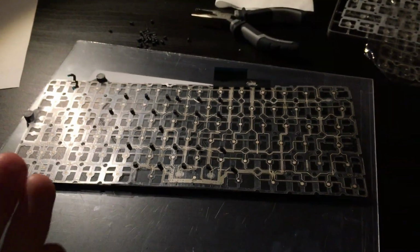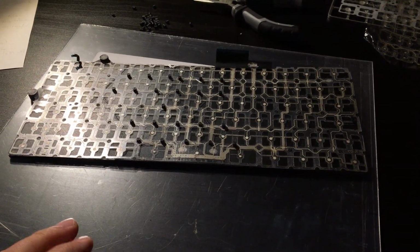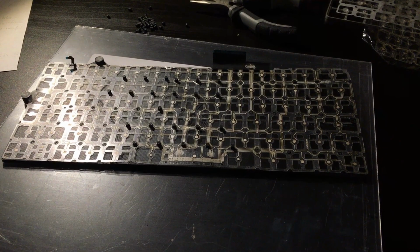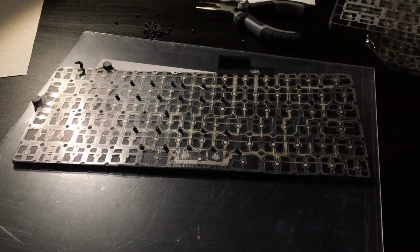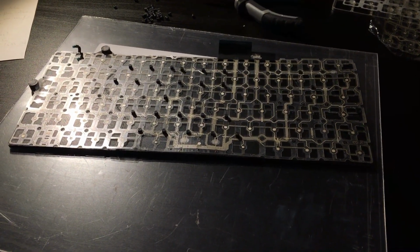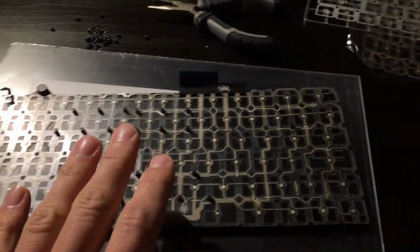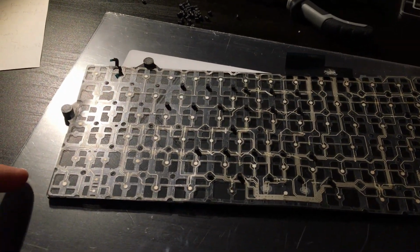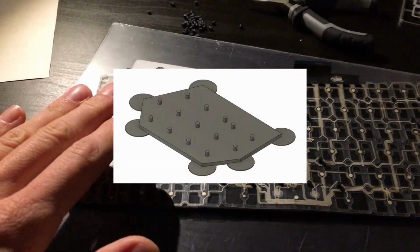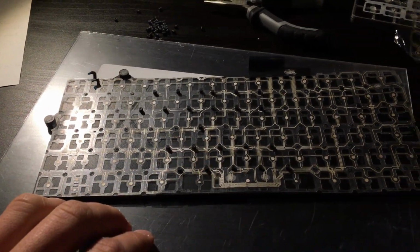I had to develop this tool, as you can see here, and I 3D printed it in the shape of a jigsaw because I'm using ASA and the warping and the issues if you don't have the material at a certain humidity and also the ambient temperature is not the correct one, then you have warping, you have stringing, you have the elephant foot, and all the kinds of phenomena you can get in 3D printing. The only thing that saved me was to divide this part into many, many parts, like a jigsaw, and also create big lumps, or big discs, on all the edges, so the parts will remain glued, let's call it, to the heat bed.